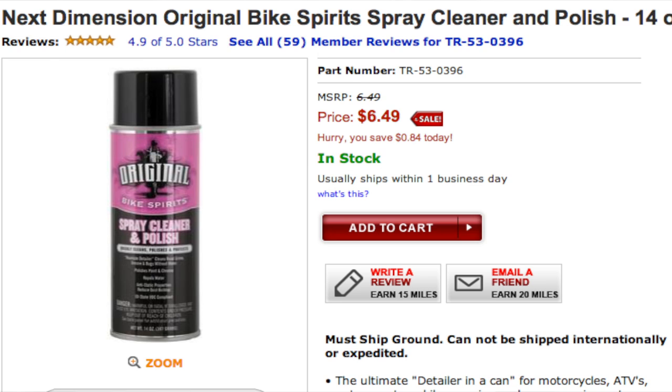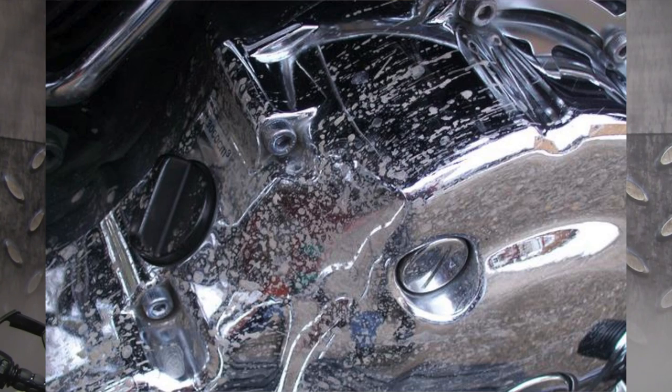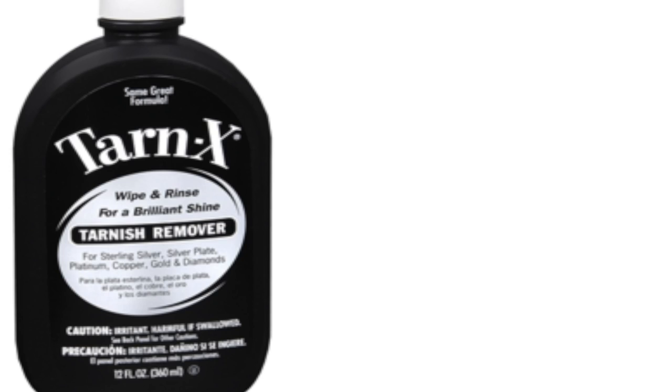When it comes to cleaning your motorcycle, you've got products like a spray wash wax that you apply and then use a microfiber cloth — the dirt goes up into the cloth and doesn't stay on the surface. If your bike is filthy with lots of road debris and grime, it's really imperative to get that big stuff off before you wipe. One product I've used and really enjoyed is S100, but there are certain chemicals in that cleaning assortment that you need to be careful with — some things will eat rubber, and some things will peel chrome.